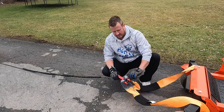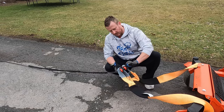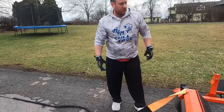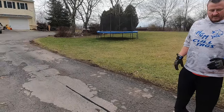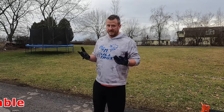So we're just going to secure the rope like so. You want to tighten your bolt down, and then when you get it tight, back it off just about maybe an eighth or a quarter of a turn so it doesn't bind up on you — that's definitely more important when you're pulling heavier loads. So now what I'm going to do is back the bad boy up until we have tension on the rope, and then we'll start winching her in. One other thing — make sure you have a good set of gloves, especially if you're doing this with cable. Obviously we have a synthetic rope, but you still want to wear gloves no matter what. If you have a cable rope, do not do this without gloves on — you might get your hands ripped up if there's a burr in the line. Synthetic is definitely much easier, but you still want to wear gloves.